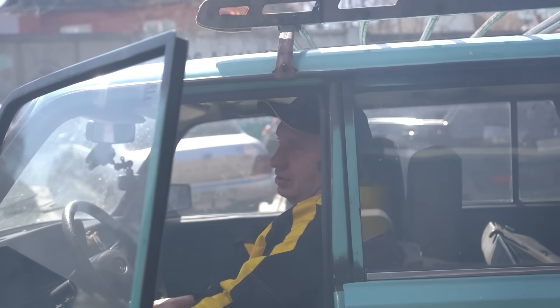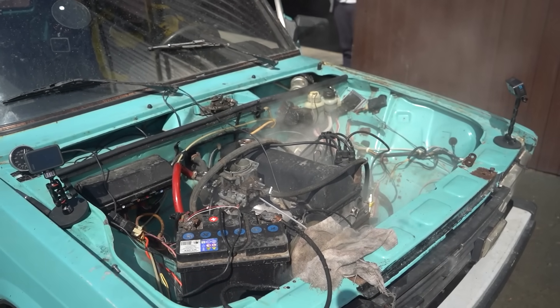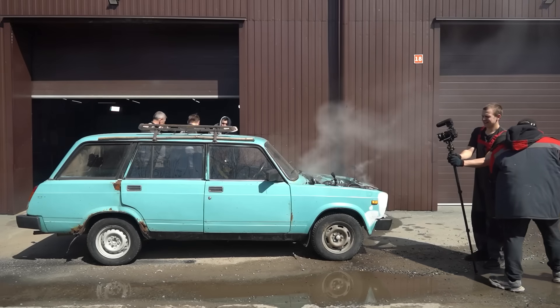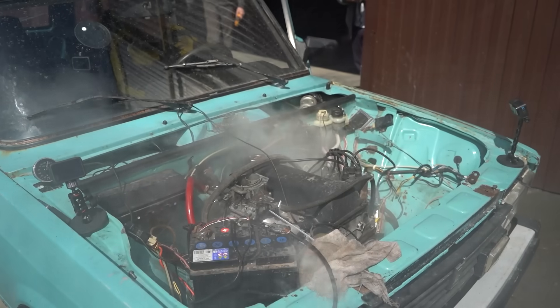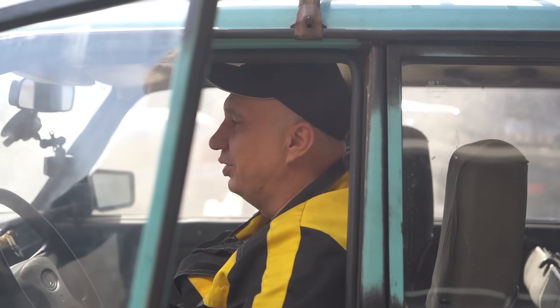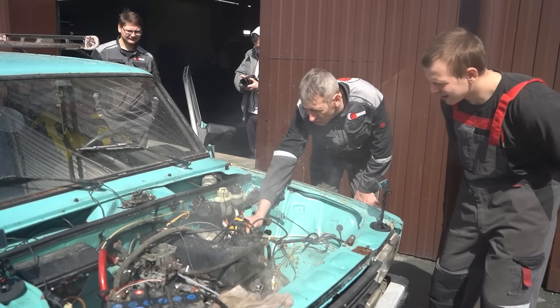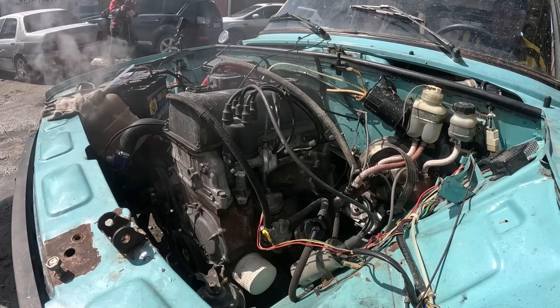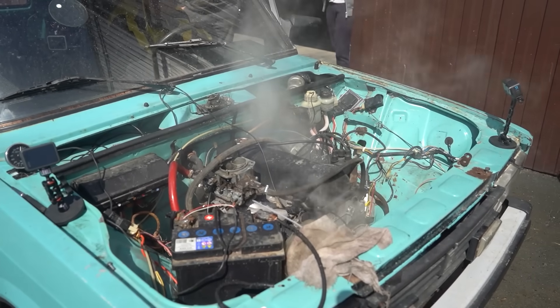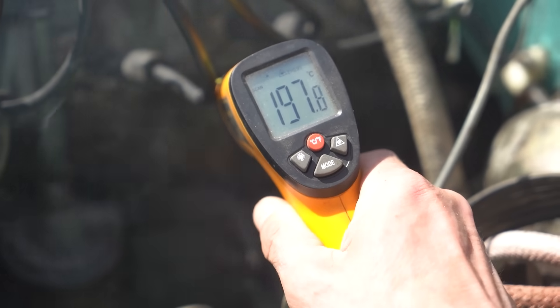This is the beginning of the end, guys — now they're starting to stick. Can you do a quick temperature check? 195 on the block, 204 on the head. Incredible. The starter motor is overwhelmed. The engine temperature is way beyond critical at this point, but even at this sort of temperature the starter motor is able to crank it. What I want to know is what happened with the non-stick coating that we covered the pistons with.